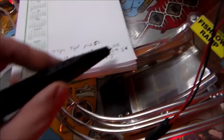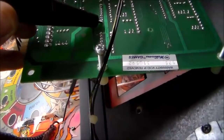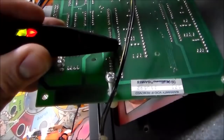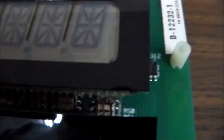I marked on the back of the board where all those chips are — U8 here, U9 here, U16 here. You have to be very careful because there's like 100 volts running through it. I hooked up my logic probe and checked — at pin 1 of U16 you've got a signal, and coming out pin 18 you've got a signal. So the signal is getting from the board fine and all the chips are good. It's got to be either the glass itself, which would be bad, or the resistors just before the glass. I'm going to take the board out and check all that.